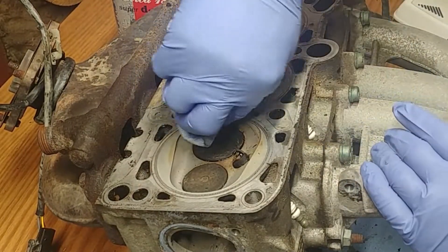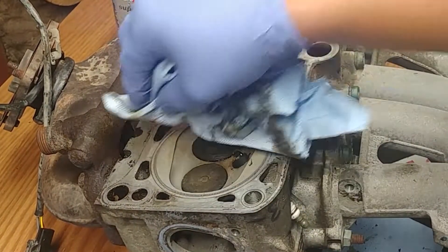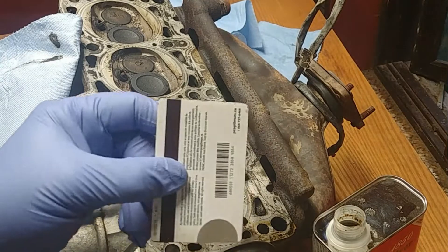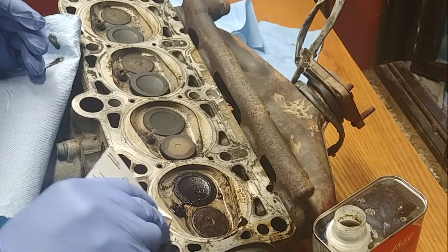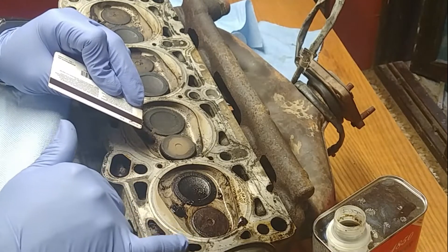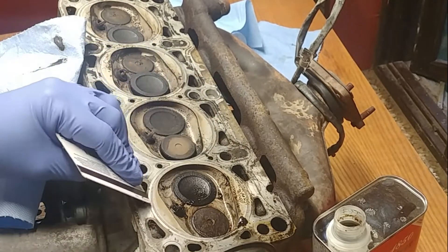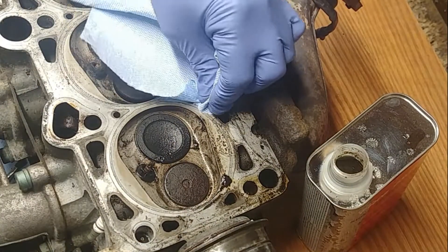You don't need to use any kitchen scrub pads, Scotch-Brite scrub sponges, or dish scrubbers. I'm using just a card — like the top of a credit card — and I'm cleaning those cylinder head sealing surfaces. Be sure to avoid scratching. Where the cylinder head gasket will seal, that needs to be spotless, needs to be clean.